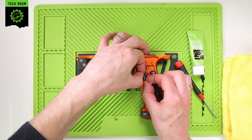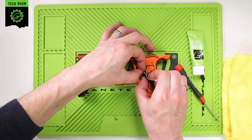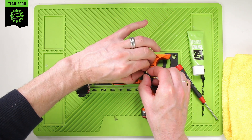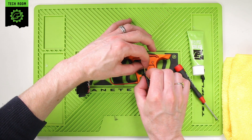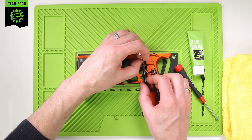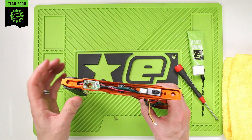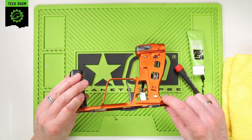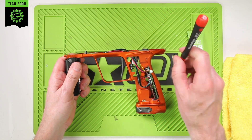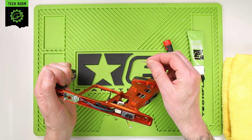It can be a little fiddly. Just rotate the wire tidy and it should pop out. Move that to one side, making sure it's not trapped on anything else. Then you have a retaining pin — push from the small side just to push the pin out, and slide that solenoid retaining pin out.